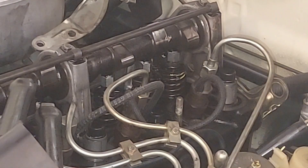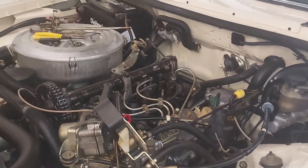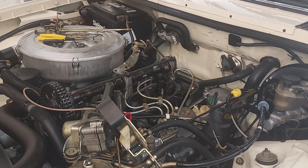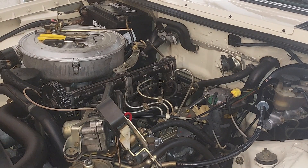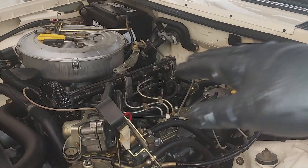That last one feels perfect — we don't need to make an adjustment. Valve adjustment is now done on this engine. All of the exhausts were too tight and we loosened them up. That'll help a lot of things: the engine will run smoother, it'll crank up easier when it's cold, and we'll probably get a little better fuel mileage. I'm going to get this valve cover back on here now with a new valve cover gasket.